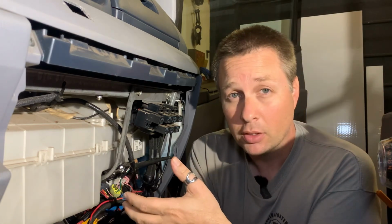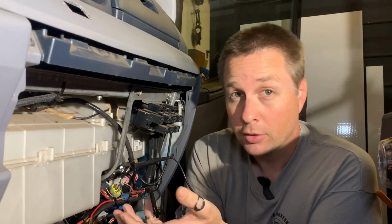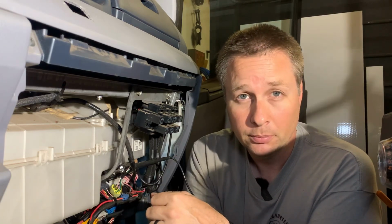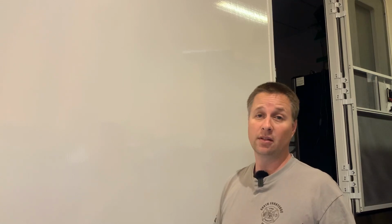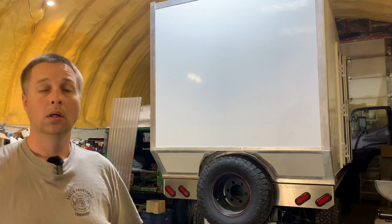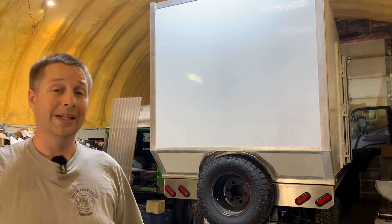And when I go back and measure them, fortunately, I guess, rather than unfortunately, the SAM is putting out power where it's supposed to. Well, I suppose it's a good thing that it means that the SAM isn't defective, but I was really hoping that I was actually about to find something there. Now that doesn't mean that the ECU is getting power.